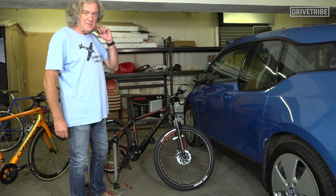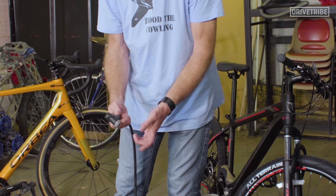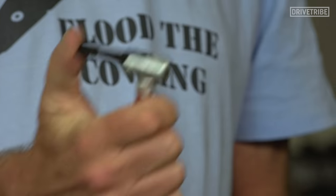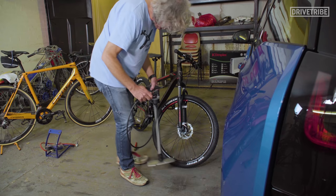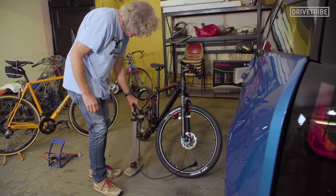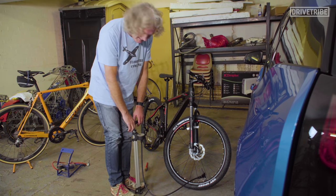Now we can pump up the front tyre of Tom's son's birthday bicycle. I'm going to use the stirrup pump with the very clever universal end. One thing you need to be aware of is which way you move the lever. On this one, you put it on and then lift the lever up to depress the pin that operates the valve. On the old-fashioned car type foot pump, you put it on and press the lever down — it will be obvious when you look at your pump which way around it works. Put the universal end on the pump, press it down firmly, lift up the lever. You'll know that it's on because the pressure that's in there is registered on the dial. It's always nice to have a pump with a pressure gauge so you're not guessing.